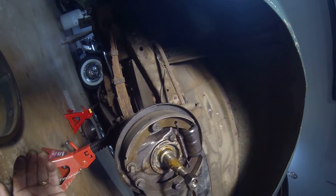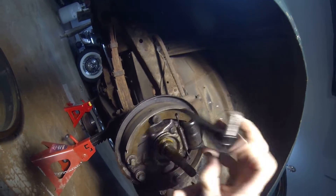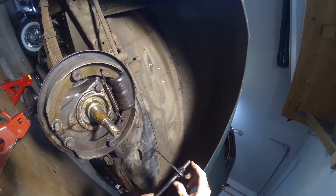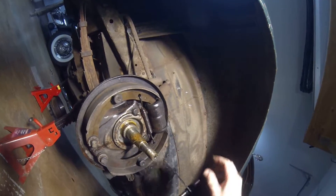You could buy the original tool, but I think the last I heard it's going for about $700 US. You don't need that - this custom version is very adequate. I can adjust the height here; I have enough threads that I can do a 10-inch drum. This is a 10-inch drum, and my 53 Chrysler has a 12-inch drum, and this tool does both.